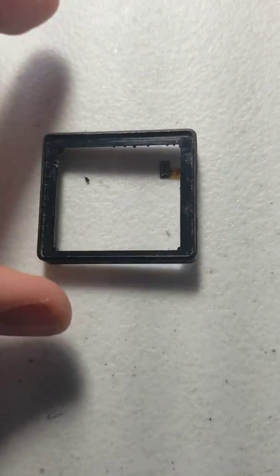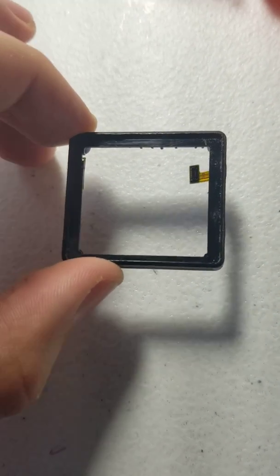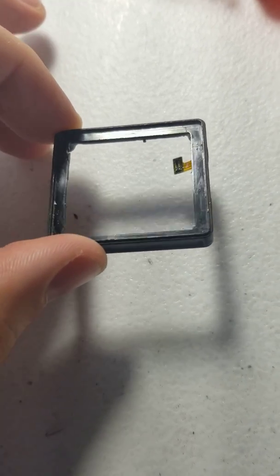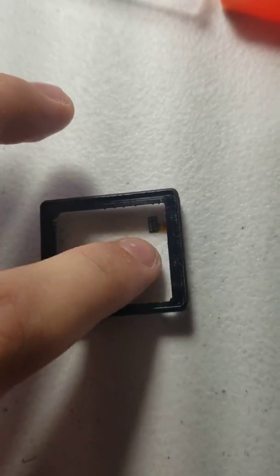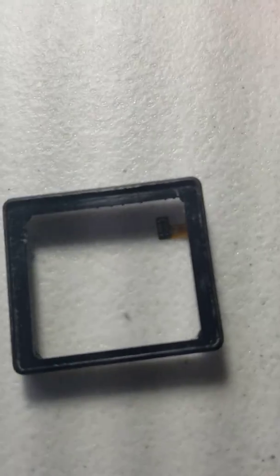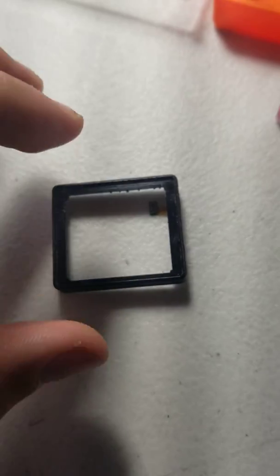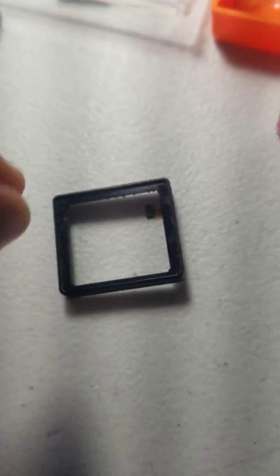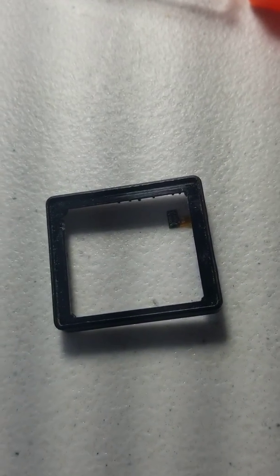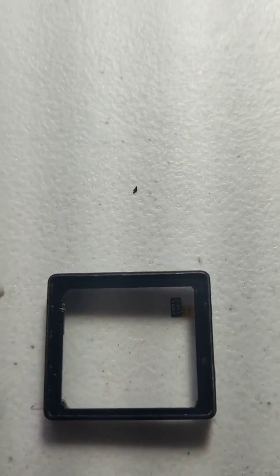Here we go with a pretty clean frame — I scraped off most of it. It occurred to me while I was doing it that adhesive probably doubles as a waterproof seal, so we're going to make sure that we run new adhesive around there and a nice bead all around it so our new LCD sits in there. While you're doing this, it's very important to keep that little ribbon cable for the side button protected — careful not to snap it down or break it off. I'm going to get some rubbing alcohol and a Q-tip and run it around it a couple times to try and dissolve any remainder of that adhesive seal. A Q-tip dipped in rubbing alcohol was pretty good in getting in that crack in there and getting any remaining residue out.